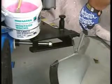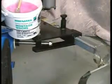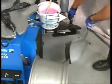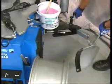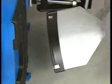Begin changing a tire by setting the bead breaker. If the tire is over 13 inches wide, first set the bead breaker in the wide position. Pull up and hold the release pin and pull the bead breaker assembly in the wide position. Release the pin in its hole to lock the bead breaker in the new position. A plastic rim protector is standard to help protect the surface of custom wheels.